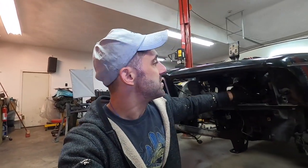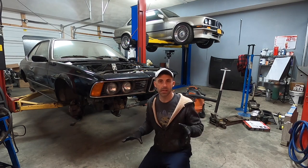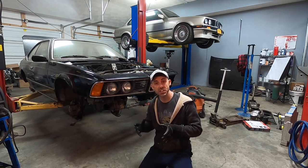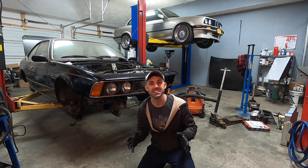On the 530 and the 540s, the brake master cylinder was located right behind the driver's headlight, just like it normally is. So I have no reservation about keeping it right behind the headlight — there are no interferences. I think this is gonna be a really nice, elegant solution that keeps it out of the way. Now that we've got the brake system installed, I want to put the engine back in the car and size everything up to see where our interferences are on that driver's side. I want to see if the power steering pulley interferes with the brake master cylinder and the vacuum booster.